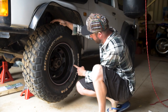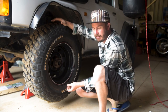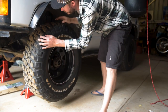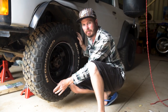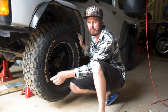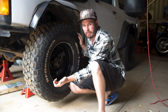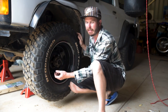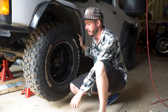Check the wheel weights — see if it's obvious that one of them has gone missing, because that does happen and then everything goes out of balance. Go around the tyre and look for any wear. If it's been a pretty long trip, your back tyres are likely to have copped more wear than the front — it might be time for a rotation. Given missing wheel weights and needing a rotation, may as well get a wheel alignment. Take it to a tyre shop and you get that done for a hundred bucks — worth it for tyre longevity and comfort.